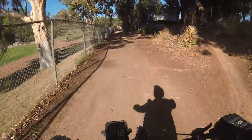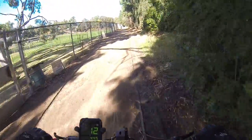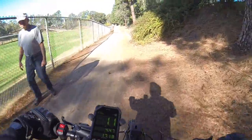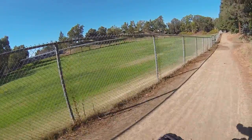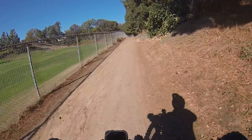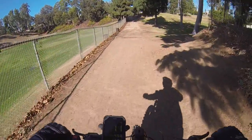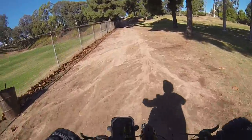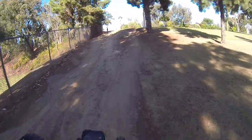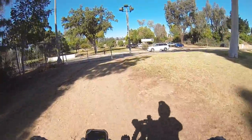Yeah, this battery, I mean, going back into 16S battery just feels right for this bike. I totally understand why Segway would put on a 58 tooth sprocket and on those 17s. Because like, it just doesn't feel right. I mean, like with the stocks we're on with the 48T, I felt like it didn't have enough balls either. So like going to a 64 tooth sprocket, or you know, even 54, just anything bigger, just felt better. Because I felt like the motor was being bogged down with the stock gearing. I mean, it was fine when I was commuting, not a big deal.